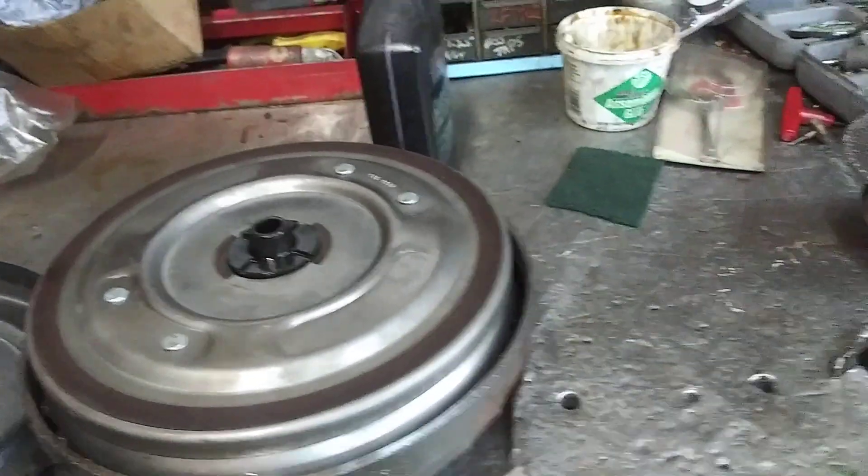The question is: when you have a P1870, can you just pull the transmission, put a torque converter in, and be done? The answer is possibly yes. I would pull the pan off, make sure it's clean with no excessive friction material or metal, update your valve body with the Sonnax regulator valve I just showed you, and then replace your torque converter.